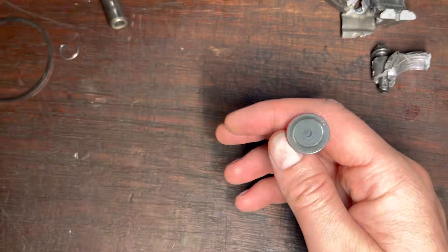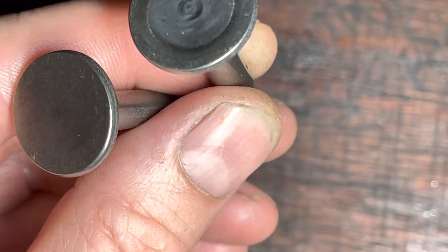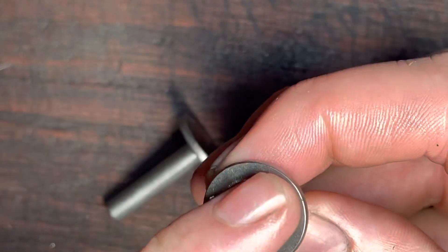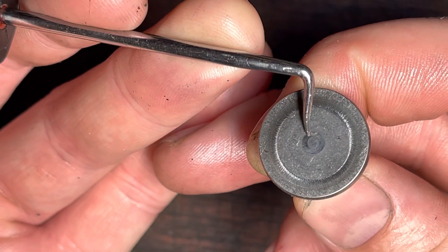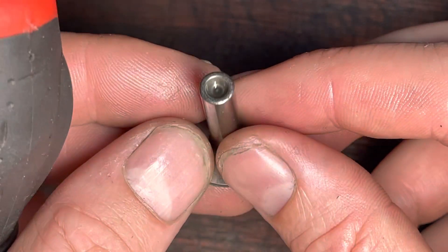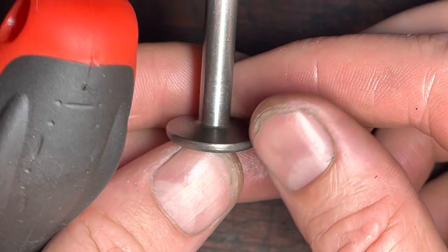And then we just have the two tappets. There are markings on one which is here, and not on the other. I think that's literally just because of some of the metal it's picked up and created that circular pattern. However, I can barely feel anything. You can see there's some wear very centrally on that — I can feel a little bit of a nub when I put my finger over it. But we don't seem to have taken the brunt of anything. That one looks absolutely fine — no nub, no damage on it.